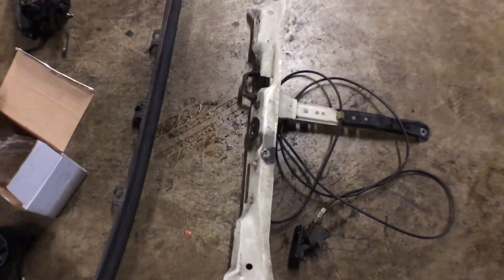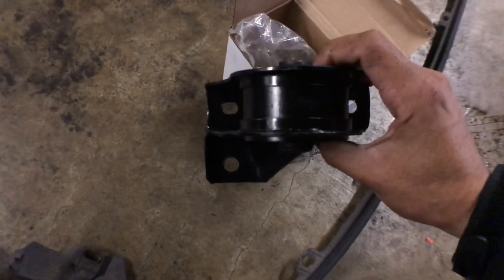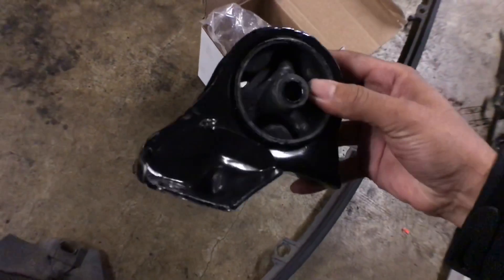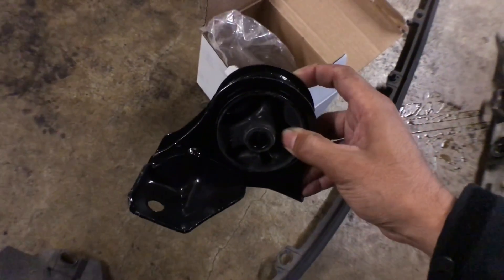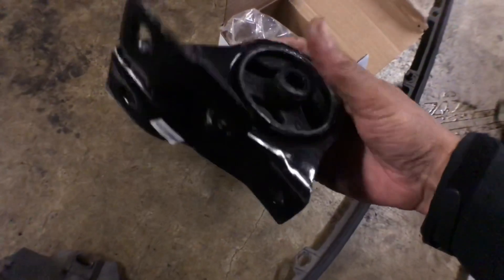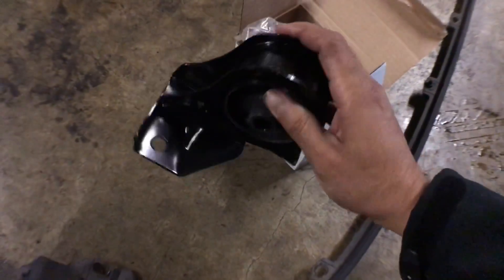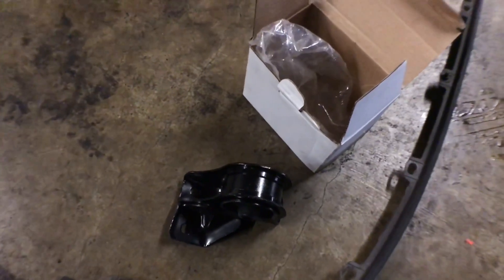I don't know why she charged me for a complete radiator support. Second piece I got is the rear engine mount. The one I have is actually busted on the bottom and missing the hardware, so it's just dangling in there. I ended up getting a fresh one and got hardware from the junkyard off of an ED3 sedan. Right now it's bolted to the bracket on one side but not the other, so every time it downshifts it just kicks the subframe.